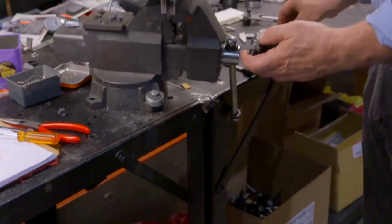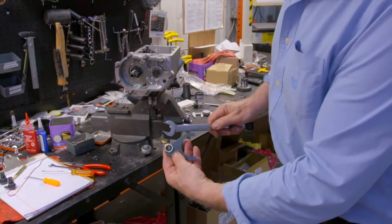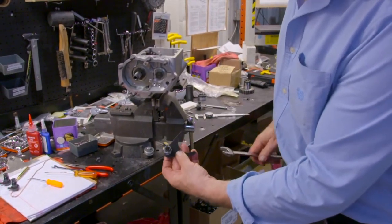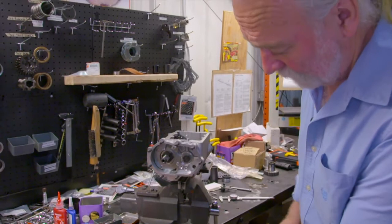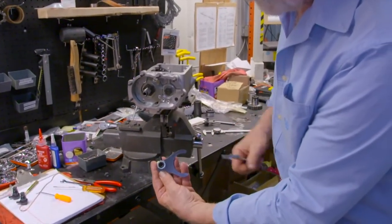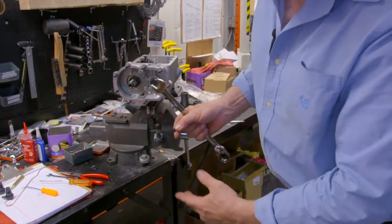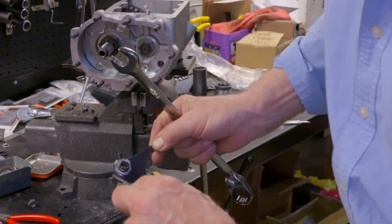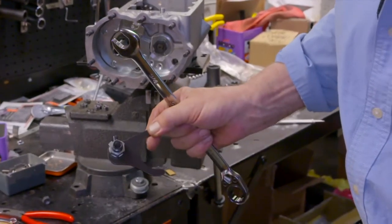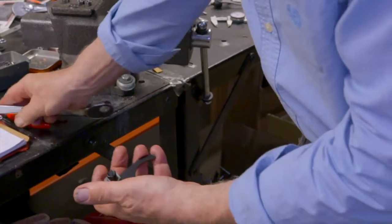Again, as I mentioned earlier, the finger roller stud on a counter shaft is at 12 o'clock high. Your fork itself for the counter shaft wants to run vertical toward me, facing from the nut end. Also, you'll notice there's a wider graduation in this fork running downward, as you can see here. That's going to be downward from the finger roller stud. This is just to give you a rough start. We'll back that off.